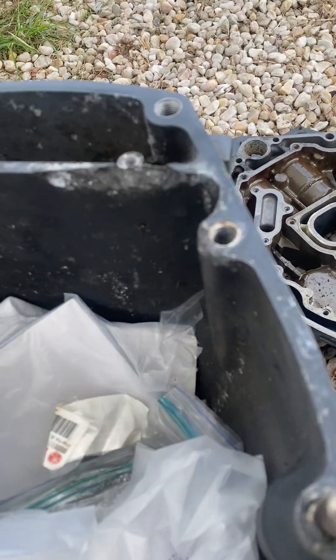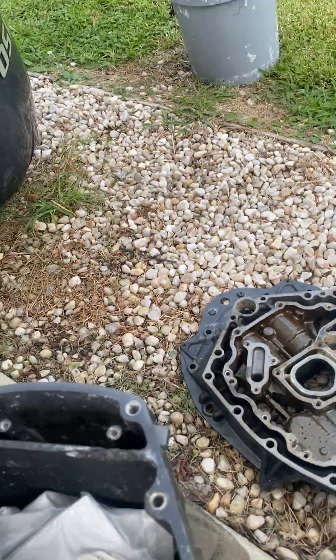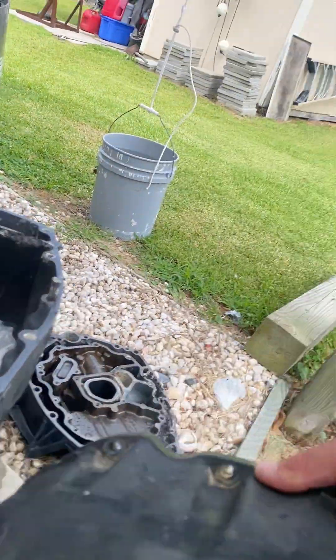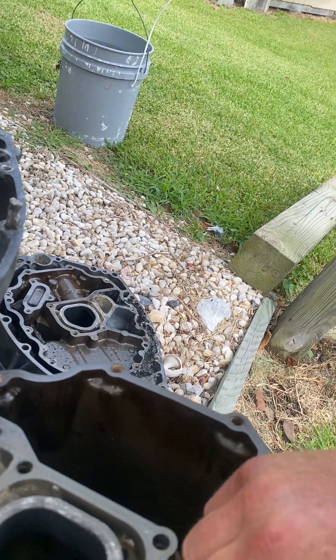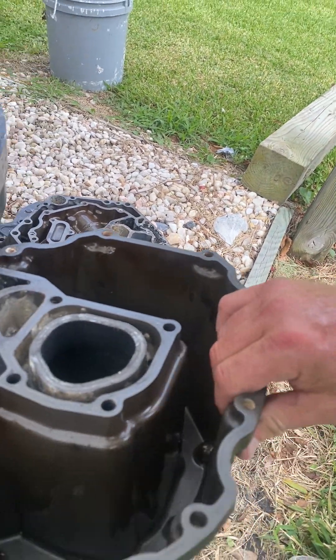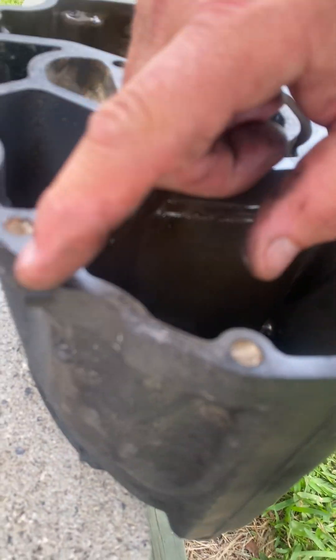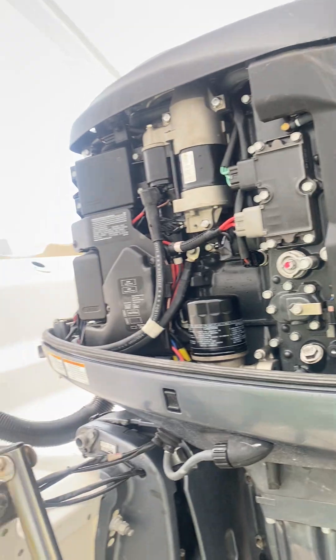Here's the midsection — you can see where it's starting to break through. Here's the worst spot of all, and if I had let this go further I'd have been in big trouble, because here is the oil tank. If you look right here, this is where the exhaust was starting to work on the oil tank. I did find a few specks of rusty steel in the oil strainer once I took it apart. In short, I had to pull the whole power head.